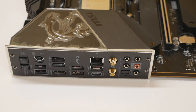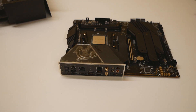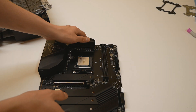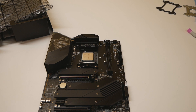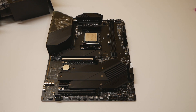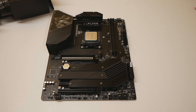So that's pretty much the rear I/O. In summary, we should have the best possible memory overclocking for the AM4 socket. We have nice compatibility for different coolers since the memory slots aren't too close to the CPU, but we don't have SLI support. So I cannot use this board to run two GTX 680s or 780 Tis for older tests like 3DMark Firestrike. That's the biggest downside — I was actually looking at AM4 motherboards and wondering which one to get myself, and not being able to run legacy dual-GPU benchmarks with the 5950X is a little bit sad.